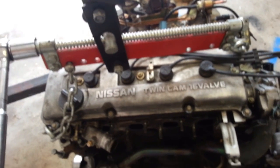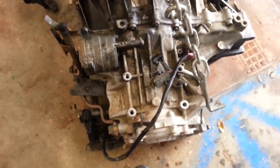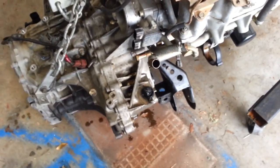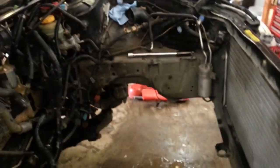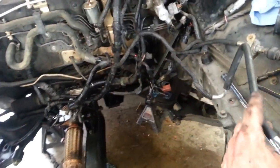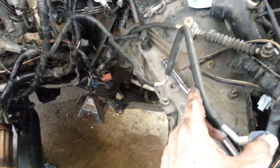I think this little tilt-and-chain thing is what made it possible. I put a bolt right there — one that's not even used on the tranny — and chained them together. I was able to move it just enough to tilt the engine just enough. I removed one front engine mount bracket off the bar but did not move the rear one — that would just be too much of a hassle. I removed the frame bracket; there's a reason why that frame bracket is removable and this one is welded on. I was able to flex the two AC lines around the engine and tranny without damaging them and without discharging the AC.